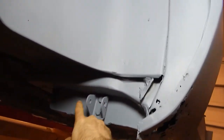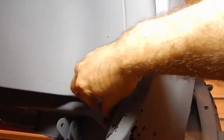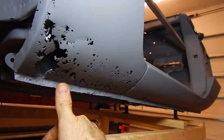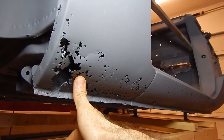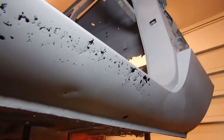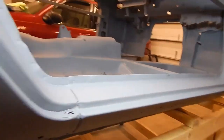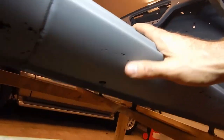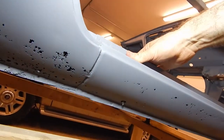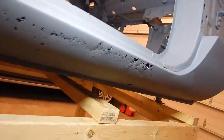Same deal on the floors on this side — this side looks even better than the other side; I can't see any sign of pitting or holes. There's a little bit of what might be seam sealer still left behind. Then we've got our rocker on this side — again, a typical damage area that's going to have to get replaced. The pinch weld is in decent shape, not eaten up, but there is some obvious damage all along the bottom. The big thing would be: if we cut this away and look inside — a rocker panel is not just the outside piece, there's an inner structure to it as well. If that inner piece is good, we might just be doing this outer piece, which is not all that difficult.